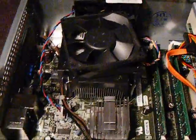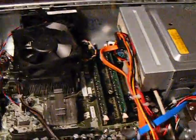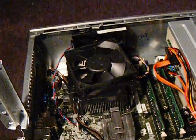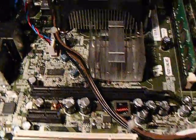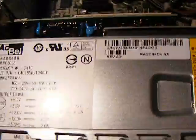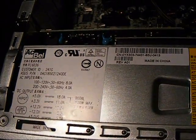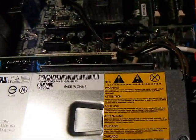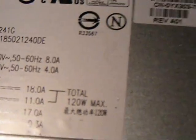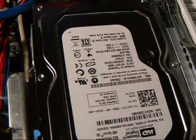The inside components are pretty cool — how Dell does all this in this little slim design case. You've got your CPU cooler, your chipset, a PCI Express X16 slot, a PCI Express X1, and your PCI slots. Generally all of these slim-line models have about a 120-watt max output power supply, along with a Western Digital hard drive — it's a serial ATA — and a CD/DVD burner.